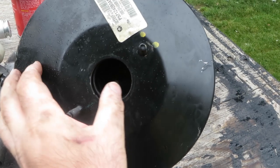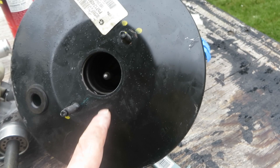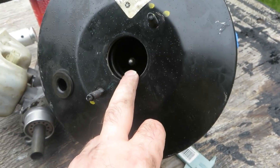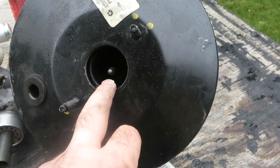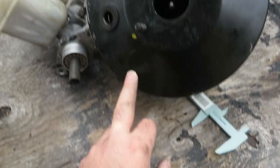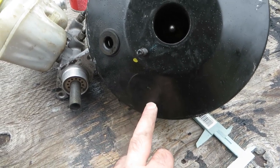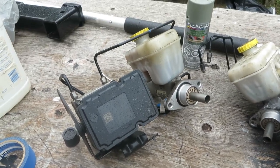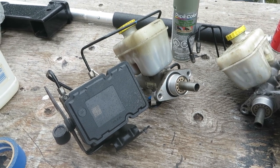Looking at the replacement master, I'm not sure if it's broken or what, but the rod moves around quite a bit and I couldn't get a good measurement on it. I also noticed the position of the diaphragm is quite different inside this one booster - without the depth gauge on it you can see there's a spot where you can punch it out. I'm going to try a hybrid of the two parts and see if that works, then put it back together and get back when I'm bleeding the system.